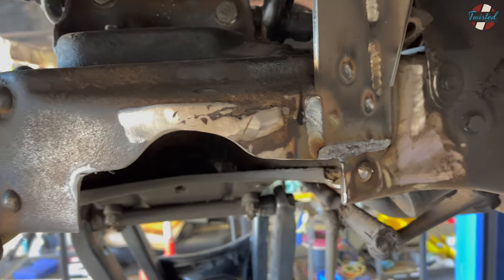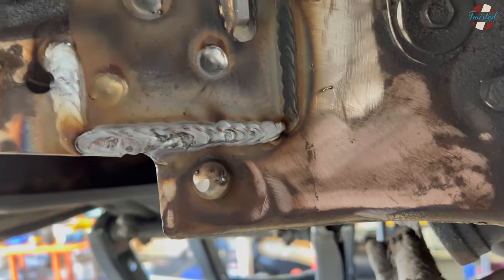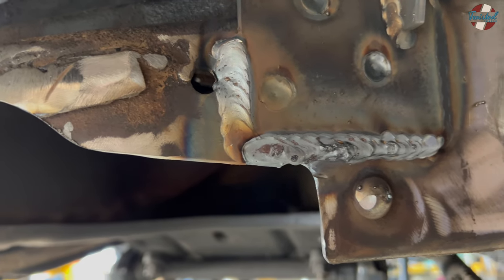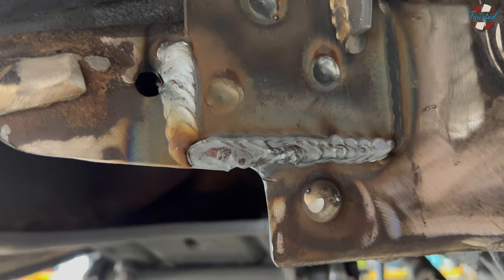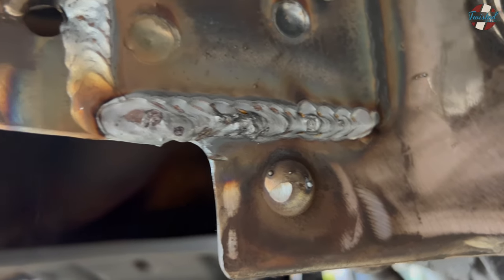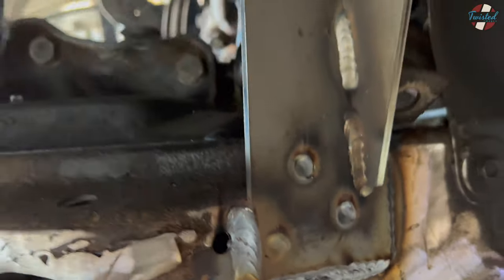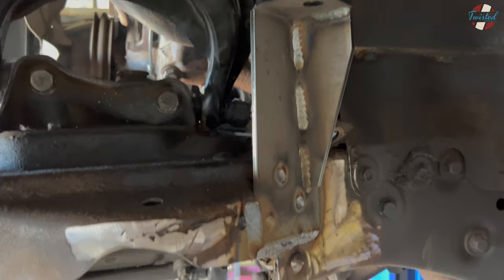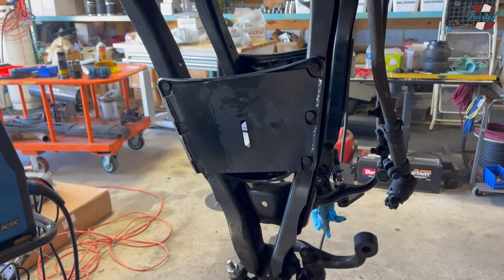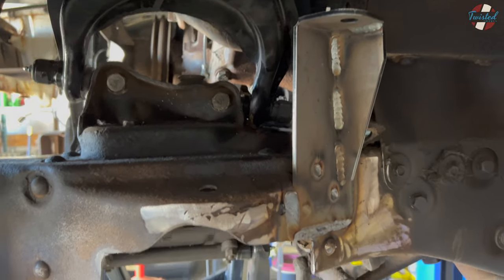While we wait for the grease fire inside the frame rail to die down — the vertical welds turned out fine. Upside down running along the bottom, there's a little bit of dirt and grease I wasn't able to get enough of out of the frame, so we got a little crud in the weld. Not going to affect the strength — it's not under that much stress — and we got those rosette welds in. Once that cools down, I'll put the suspension back together, measure for exactly where the lower mount needs to be, and then we can paint everything and hopefully assemble for the final time.